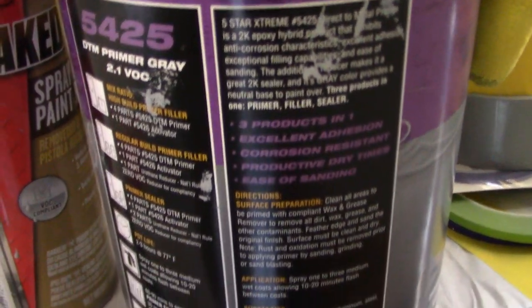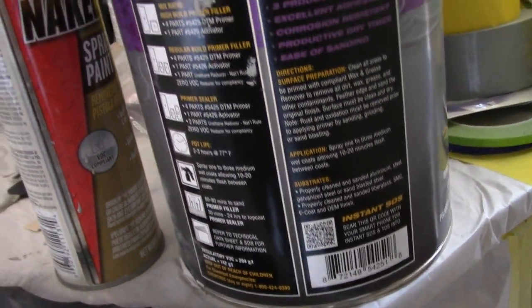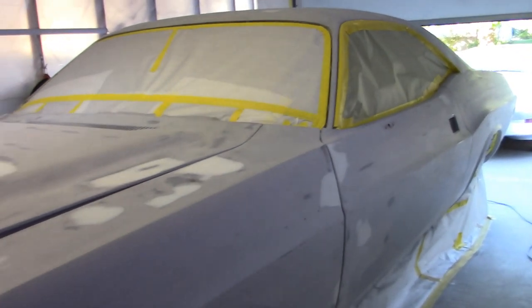And so tomorrow morning, I'm gonna spray a whole gallon of direct to metal high build primer. So any spots that's showing a little bit of metal, because the dark primer is the sealer, the epoxy, and then this is the high build primer, but it's a hybrid epoxy. So it's epoxy hybrid with like a polymer or whatever it is, polyester. It's not polyester, but it's a poly. So all the little itty bitty spots that's metal flashing should be good to go.